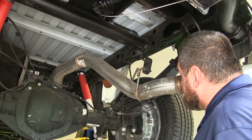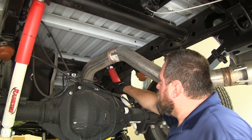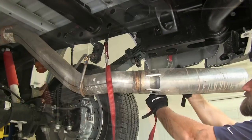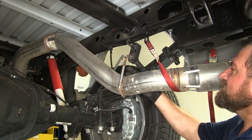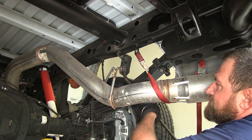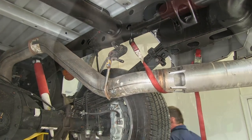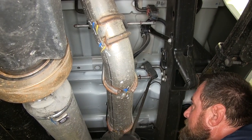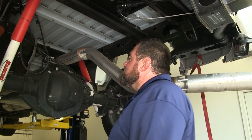Now we're going to need to lower our exhaust down a little bit. We'll start by taking off the rubber isolators — one in the back, two in the front, and one a little further out. We'll take a safety strap just to support it while we loosen it up. The vehicle is new and still has a little bit of grease on the grommets, but if yours has some age on it, use a little spray lubricant so they'll slide off easier. Once they're all removed, we can lower down the safety strap, giving us just enough clearance to get our plate installed.